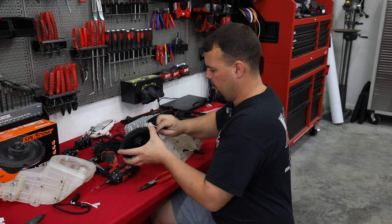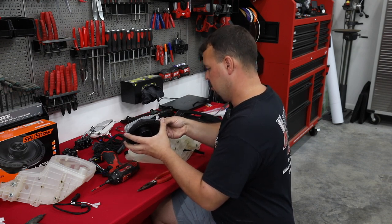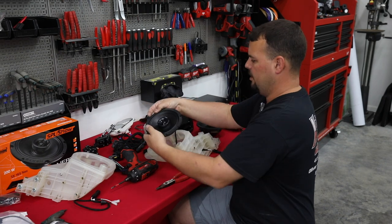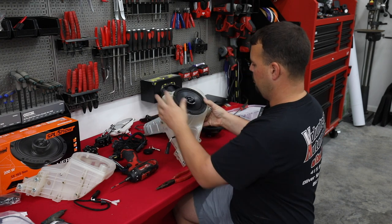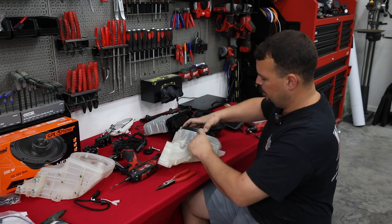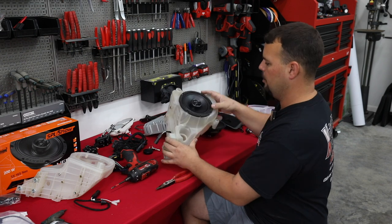Normally when you get new harnesses, you don't have to go through that process, but just making sure. All right, so we've got our speaker plugged in. They're good and tight. We don't have to worry about them coming off. Now we're going to drop our speaker in, and you're going to notice, if they haven't already cut it off for some reason, it's a little nub that sticks up, and it fits perfectly on your Hertz speaker, so it's all going to line up properly.